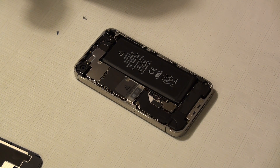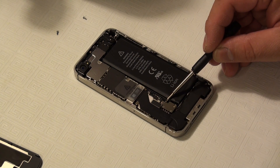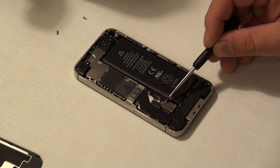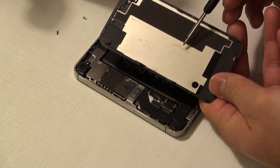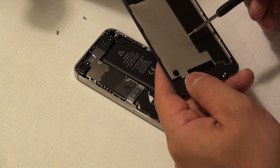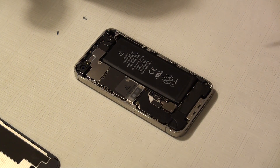Before we do any dismantling, I want to point out three key things that the iFixit video actually kind of misses. We need to make sure that when removing the screws we pay attention to the ground strap that exists here. This little grounding spring — it's not really a strap, it's a spring — makes contact with the back of the iPhone 4S's case to create continuity, grounding, and RF shielding so that the cell phone and Wi-Fi work properly.